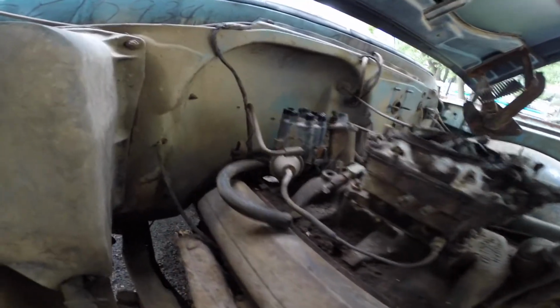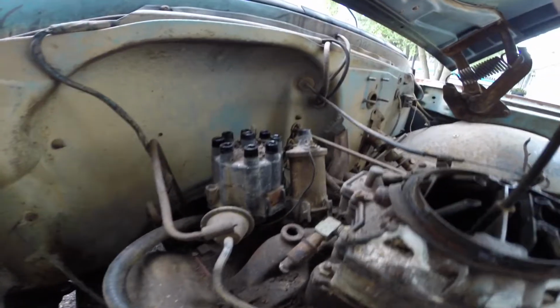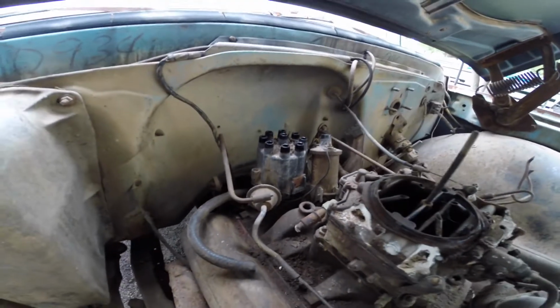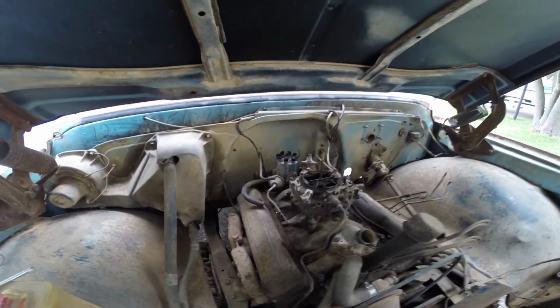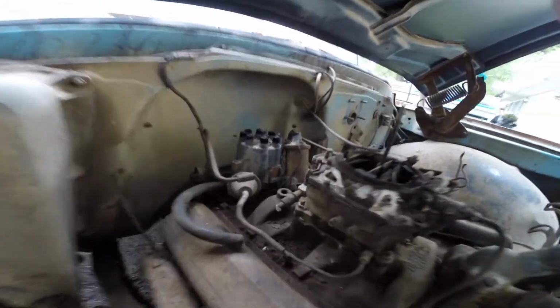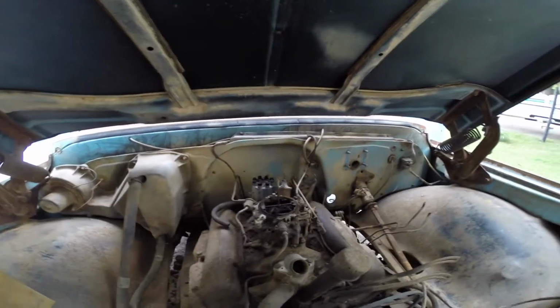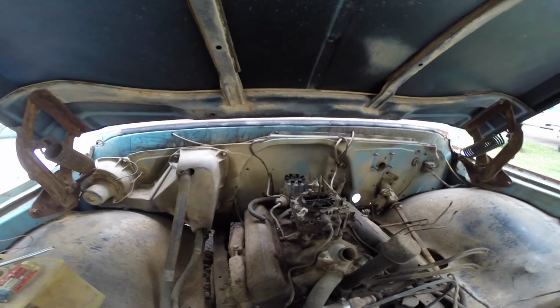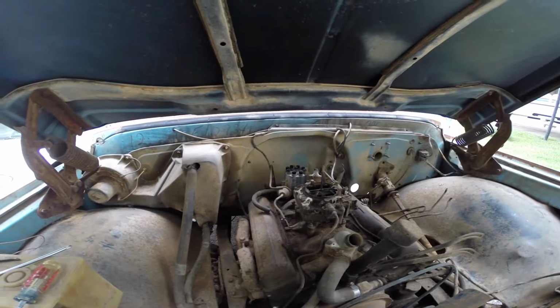But this is what it looks like. I'm missing a valve. We kind of figured it out with the help of a catalog. It's sending vacuum down to my transmission and also to my brakes, which kind of makes sense because someone had taken the power brakes master cylinder off here, so that makes sense they took that, which is cool. You know, problem solving, figuring things out.